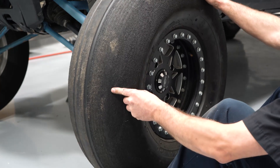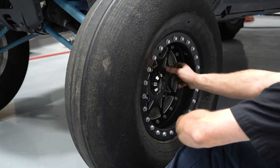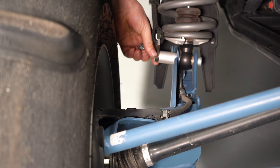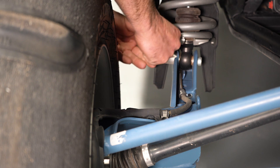Now that the installation is complete, we just wrap it up by putting the wheel back on and we'll bring the vehicle to the ground. The starting point for the rear wheel bearing replacement: if your vehicle has limit straps, you want to unhook them from the suspension so that they don't have a torsional effect while you remove the radius rods.